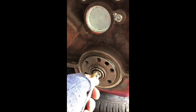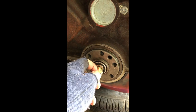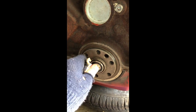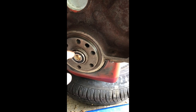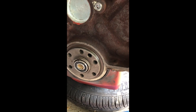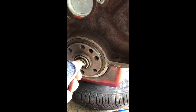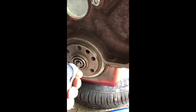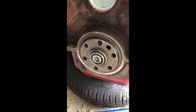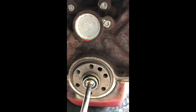There's a formula for this — some people use grease inside here as well as bread, and I did not do that. Also they're using up to four slices of white bread; this is just one slice of wheat bread. And you can already see that the pilot bearing is moving out, so I'm just gonna keep cramming this in there. This is a really ridiculous way to do it, but I don't have a puller.